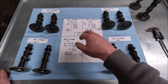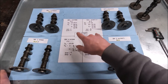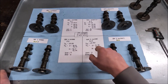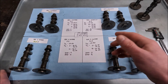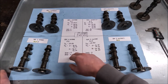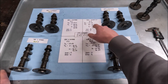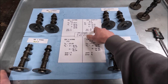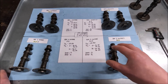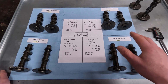These are the camshafts I'm looking at. I have a set of first-gen intakes and a set of first-gen exhausts — these are the camshafts I pulled out of this engine. I have a set of second-gen intakes and a set of third-gen intakes. The camshaft swap involves swapping a set of second-gen intakes to replace the first-gen intakes, and then swapping a set of first-gen intakes to replace the exhaust. I'm just going to go with the standard second-gen swap.